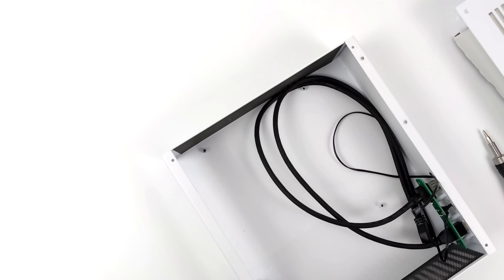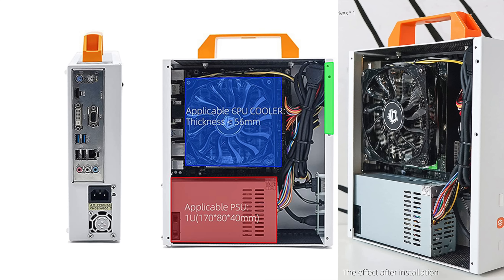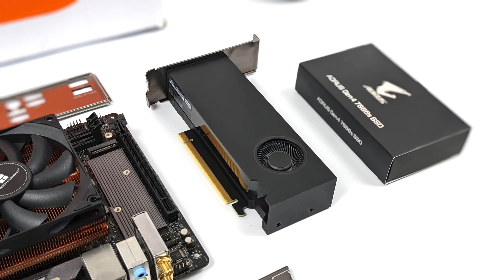It's not meant to use a GPU — this is more of an APU or integrated graphics case. I wanted to give you an idea of how this should go together if you're using it for integrated graphics. It uses a 1U PSU right there at the bottom, so really when it's set up like this, there's no room for a GPU, but we're going to kind of disregard this and make it work. The bread and butter of this build is the RTX A2000. You can pick these up used on Amazon for around $250, and I'm going to tell you right now, it's well worth it if you are already thinking about picking up something like a GTX 1650 low profile. This blows it out of the water, and with it overclocked, it does outperform the RTX 3050.